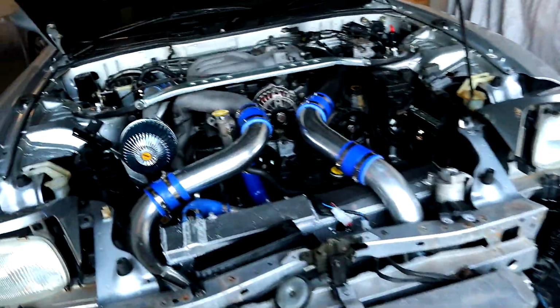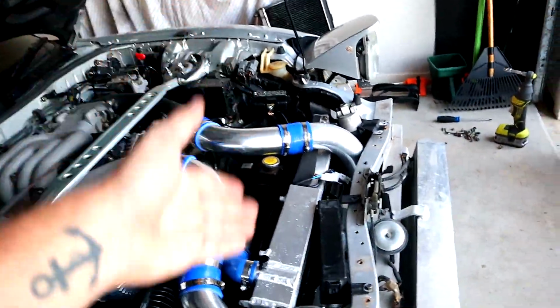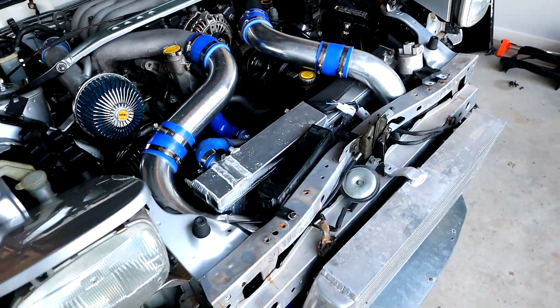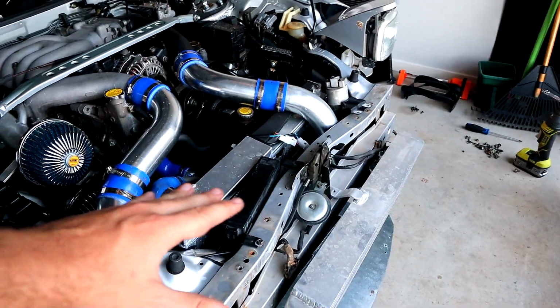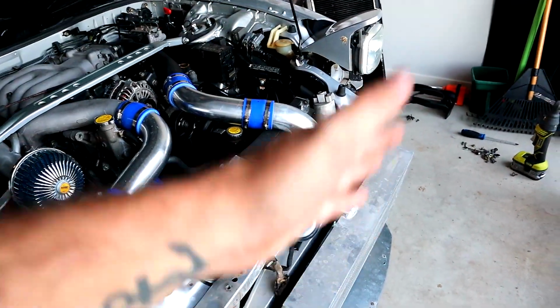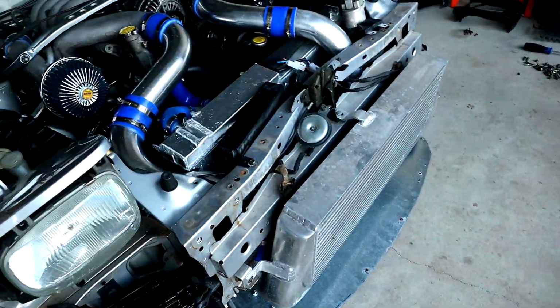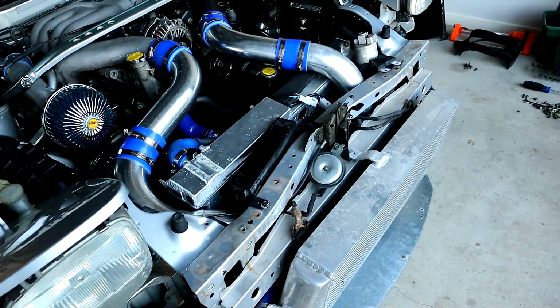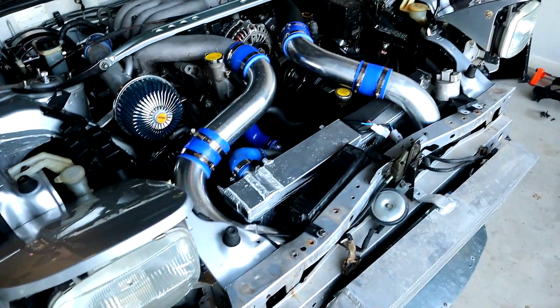And in my case, because the radiator is very ever so slightly angled back and sitting behind the condenser at the same time as well, I could imagine that the air was probably passing through that right there and then going to the condenser, either slowing down too much or just going straight down and underneath the car. So that's why I thought the cooling panel on the bottom might work. It didn't work, unfortunately. So yeah, this is why we're going to get rid of the entire setup.